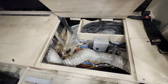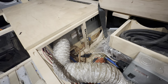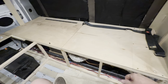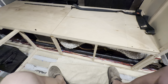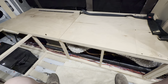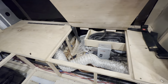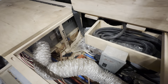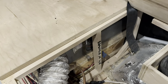Over on this side, this comes up also — you have the little breaker down there for the shore power and some gas and plumbing lines, and another part of the furnace. When I built all of this it was a lot of extra work putting all these little doors on, but since this front face will all be sheathed up with planks, I did want to make sure I'd be able to reach and service any of these parts. A little extra work but I think it'll pay dividends.